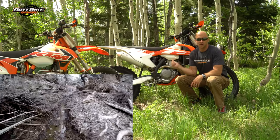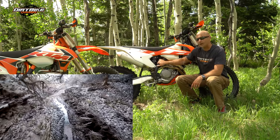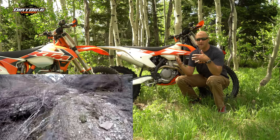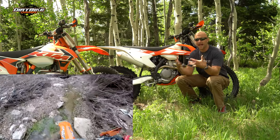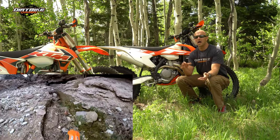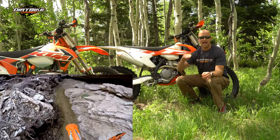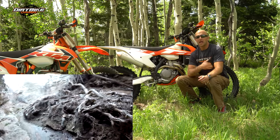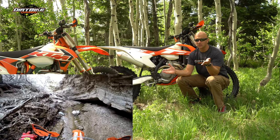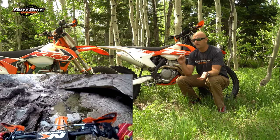The dirt bikes don't have that. They have an altitude sensor, kind of a barometric sensor inside the throttle body, and they're definitely mixing and vaporizing and atomizing the fuel a little bit better than a carburetor would, but it's not head and shoulders above a carbureted model. If you can get your carbureted model jetted in the range for your altitude, they run phenomenal.